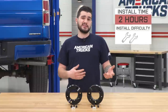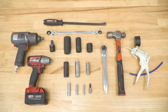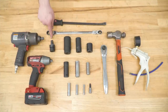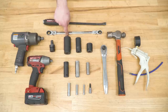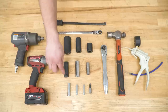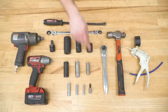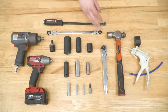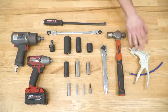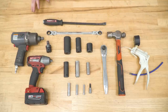The install is going to take you about two, maybe three hours from start to finish. Tools used in this install include an air impact gun, an impact gun and/or a ratchet, swivel socket, 30-millimeter deep socket, 15/16ths, 27, 21, 19, 17, 13, 10, and 8-millimeter deep sockets, 8-millimeter hex socket or Allen key, half-inch ratchet, hammer, vacuum pump for four-wheel drive actuators, 15-millimeter ratcheting wrench (heavily recommended), and a pry bar.